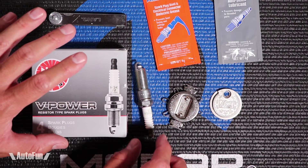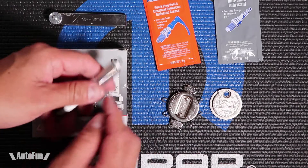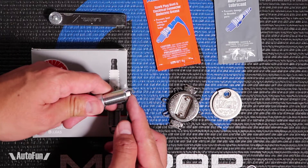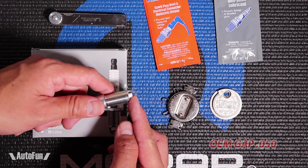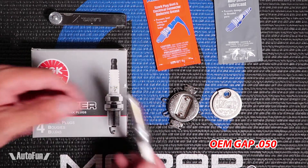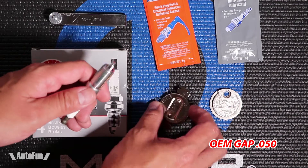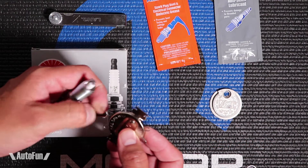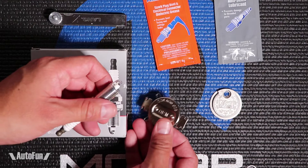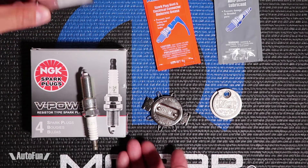Now that's really neat in that it saves time of having to change them out, but I don't like to keep an old spark plug for a long time versus copper. These are for stock applications. When you have a stock application, the gap — the spacing between the electrode and the tip — is gonna be 0.050. These spark plugs already come pre-gapped, so all I have to do is insert them into the engine. It is always good practice to verify the gap of the spark plug before putting it in your engine, just to make sure nothing has changed, and NGK talks about this.